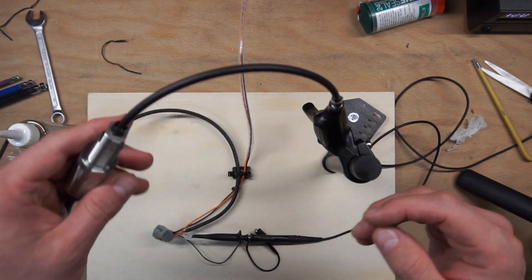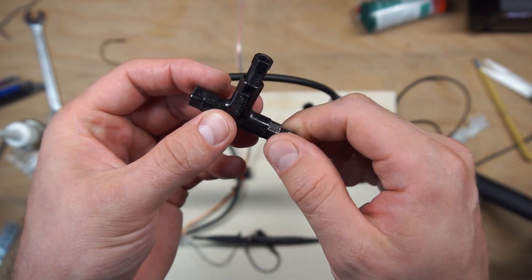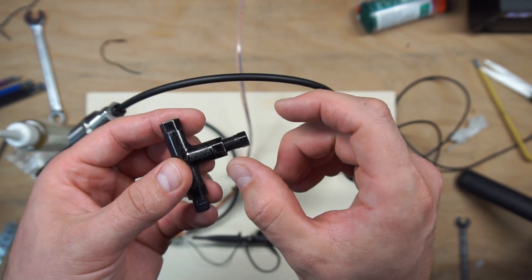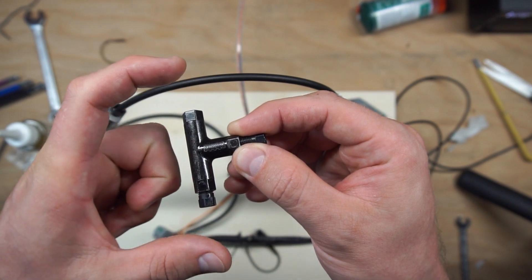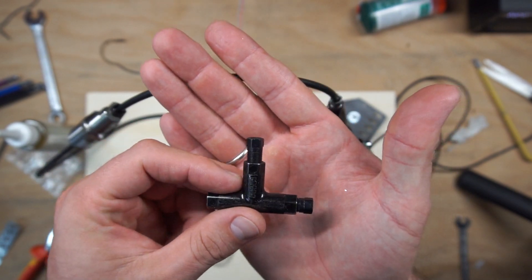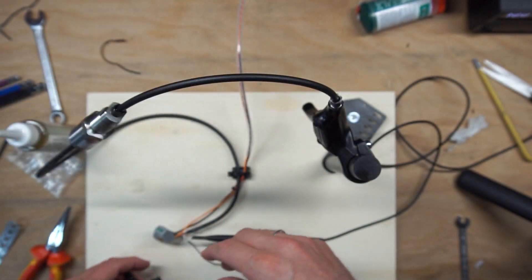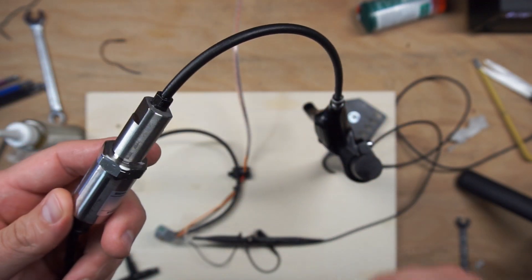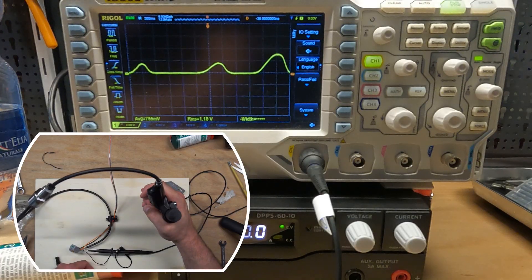This system we will use in our e-bike. We will connect it using this connector — the pressure sensor in the general line to the caliper from the lever. In our opinion, these pressure sensors should be mounted closer to the caliper to reduce the hydraulic dynamics impact on response time in the system.